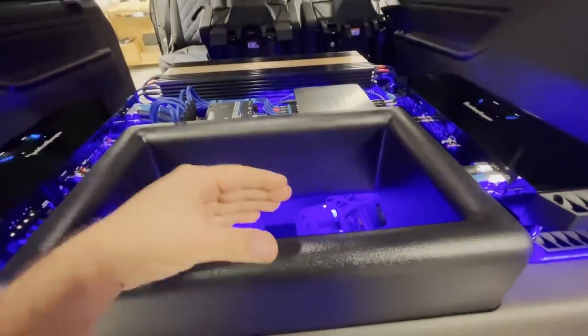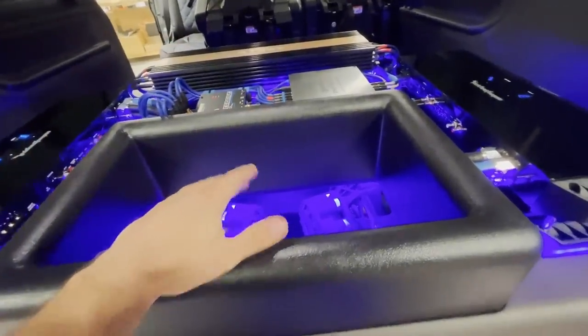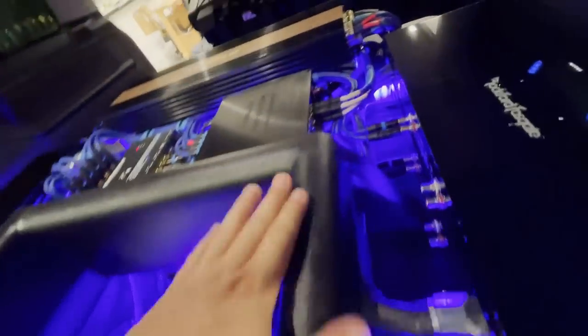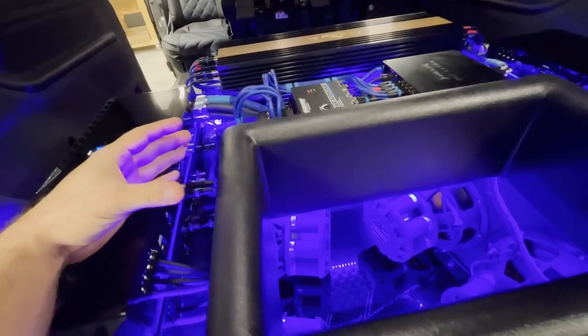I spent a while experimenting with the heat shrink to see if I could get it to turn without puckering, and that was the limit on the turn, so I had to sink it into the port. There was no other way. You didn't want to extend the port that way either, because then that reduces the space there. And little things like this part of the port also acts as a brace for the top section of the baffle.